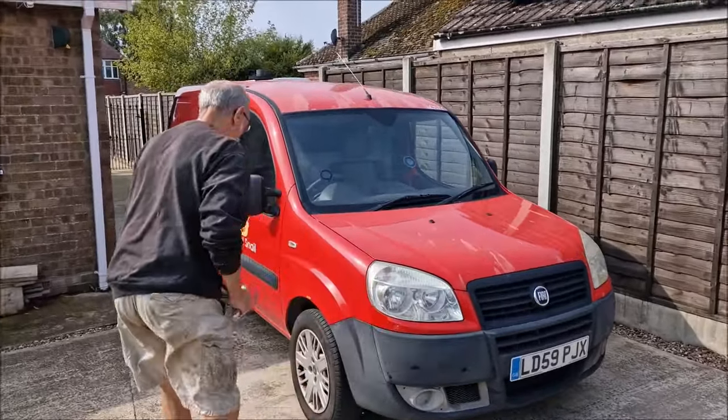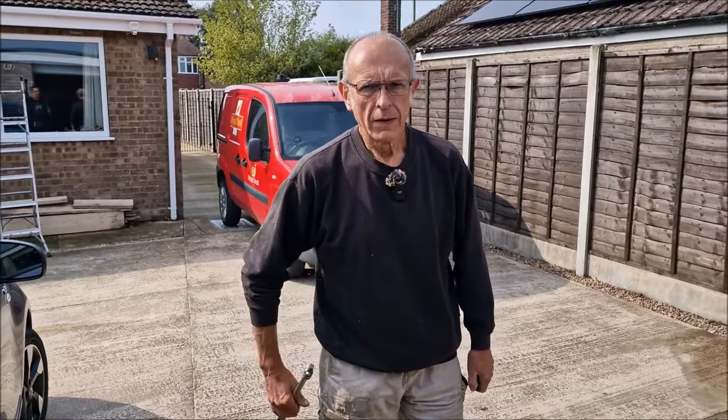Hello, good morning. We're back with the Royal Snail Van because we've still not found what that noise is. You're saying you can't hear that noise. Now we've cleaned the back it is still there, as we discussed in our previous video. We've developed a squeak at the front as well — a squeal. You've heard the squeal a couple of times when I've been pulling up, and even Mrs. John Cooplin has noticed it, so it must be a terrible thing. Could it be unconnected, this squeak? What are you expecting to find today? A lip on the discs, on the brake discs and pads. Are you expecting us to have to replace them? I hope not because we haven't got any — I'll have to nip down to AP Titans tomorrow and grab some. So the plan is we're going to get the wheels off, jack her up, have a look at the brakes on the front. Let's get them wheel nuts cracked — I'll get the right socket.